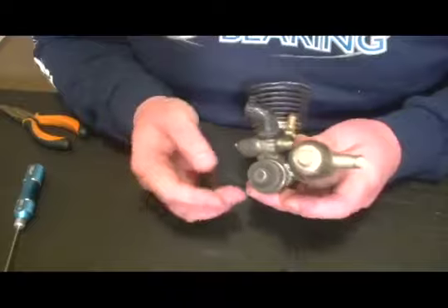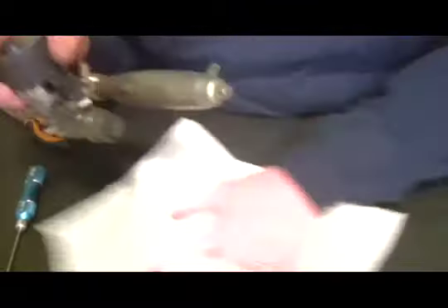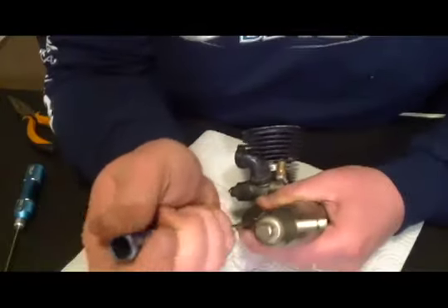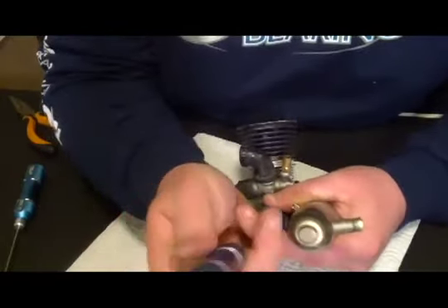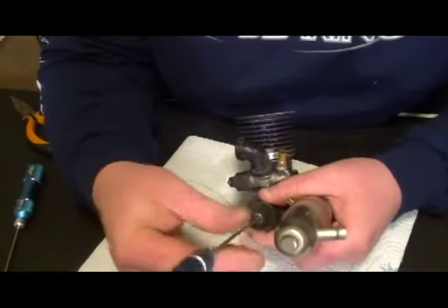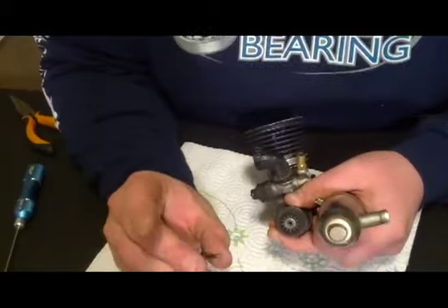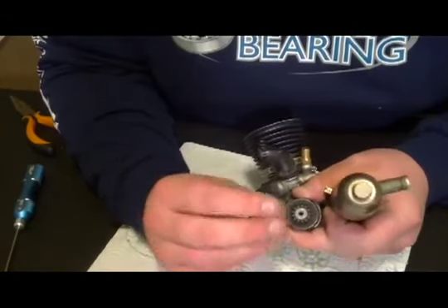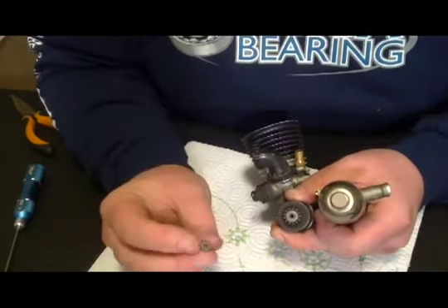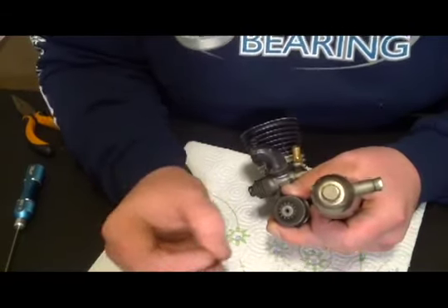We have our clutch bell hooked up here — it spins pretty freely because it does have a pretty fresh set of bearings in it. I'll take my 2.0 and remove the screw at the front that holds the bearings and clutch bell in place. I typically like to use the screws that come with the Savox servo kits if your motor's tapping allows for it, because it has a large diameter head, works perfectly, and is long enough that it will only come out a small amount if it ever breaks free.